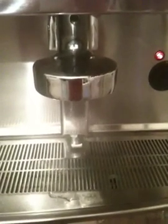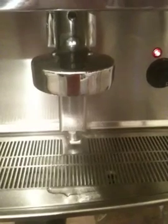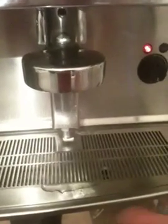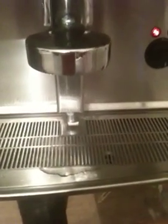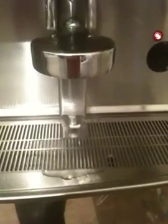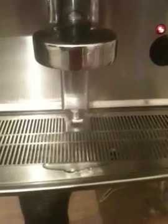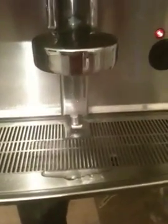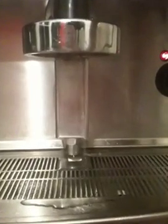and this is something you should always do if the machine's been sitting for a while and you need to make a coffee: run this water off that's been sitting in that coil. I don't know whether you'll learn about this in the Barista College course, but I may as well tell you now. So this water should start to settle down, and should be cooler water, so to speak, in any time now. Here we go. That rushing sound is dying off. There we go.